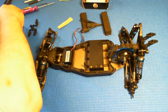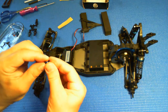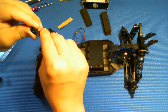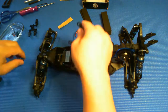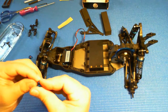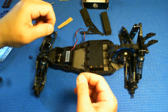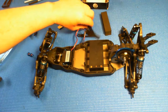There are a couple of O-rings provided, and you just slide them right over the top into that groove. When they drop down in, you've got a little bit of a cushion effect. That will help — you won't have to torque these down so tight trying to make sure they don't loosen on you. The friction of the little rubber O-ring will prevent them from backing out, so you don't have to crank them down until they lock in and overstress the arm.